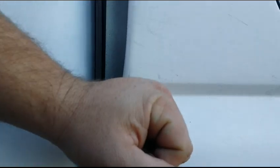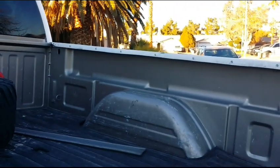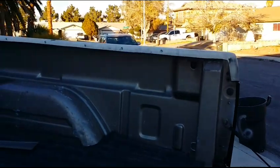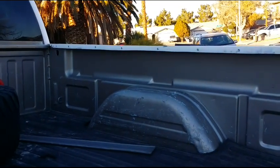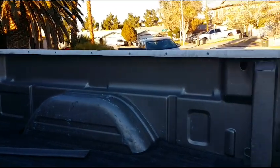This line right here — you can see the bedside is up a little bit higher. The bed has solid mounts on it. The truck is a 2002 and it has rubber mounts on the cab. My brother has the same truck but a 2003 — he replaced the cab mounts and it raised his up that half inch to line those back up. There's that side over there. Self-tappers all the way through.